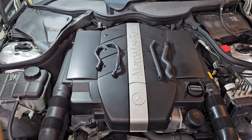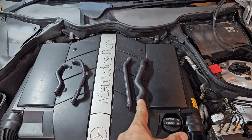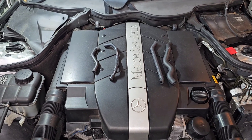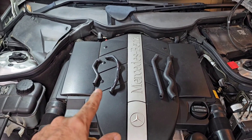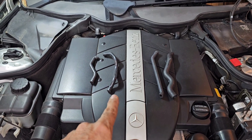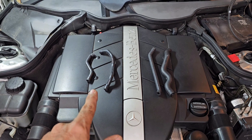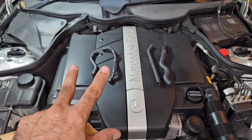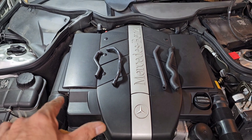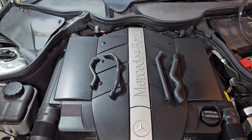You will inhale better and cleaner air because all that fuel crankcase smells won't come into the cabin. Fourth, you will get better performance because any air leak from these hoses will be unmetered and will definitely affect the performance of the car. And finally, the fifth benefit: these days with fuel costs, it's going to consume less fuel with a healthy PCV system.